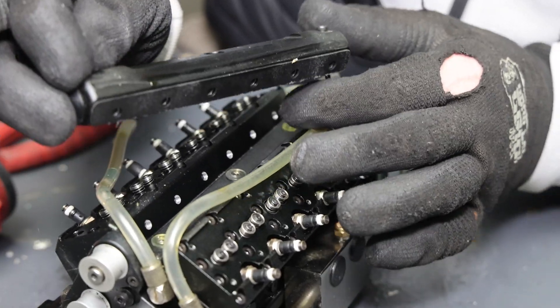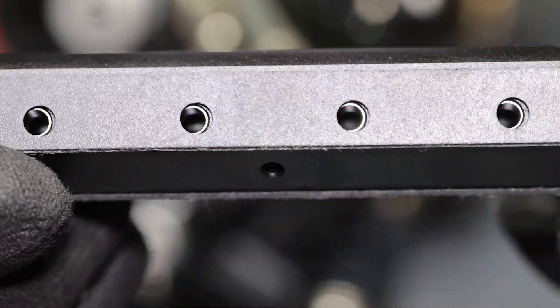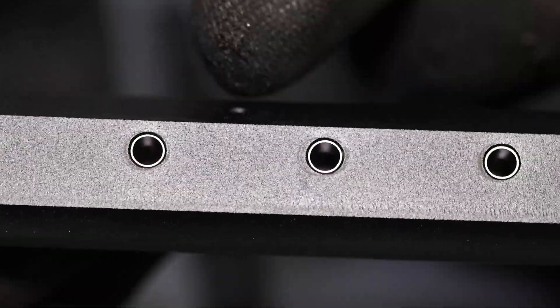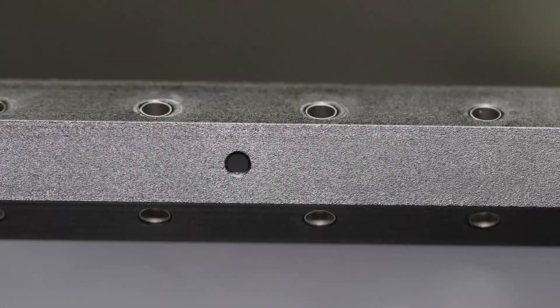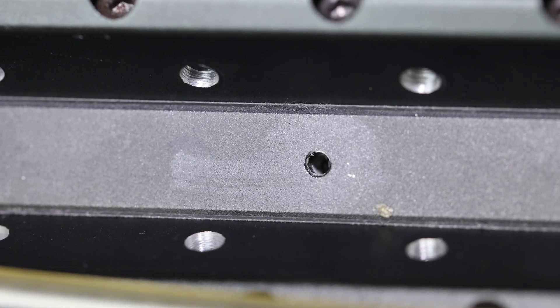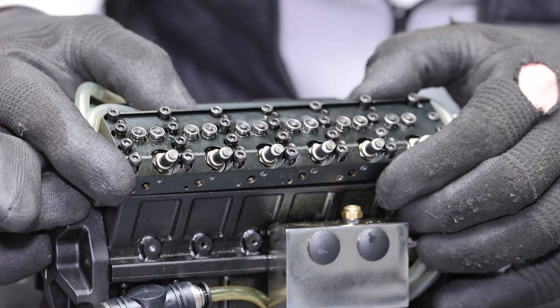There's the tiny little manifold. Look at those holes — that's cutting off a good 20 to 30 percent of the opening. If you look at that hole it looks like it's centered with the intake holes — that looks symmetrical to me — but if we look at the block we can see that those holes are offset. That's a lot of head bolts actually. Let's pop that... oh, that came right off.